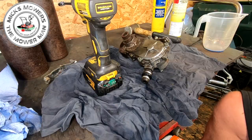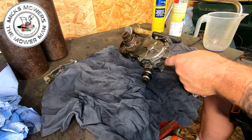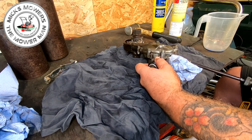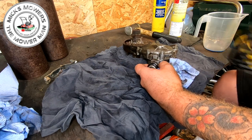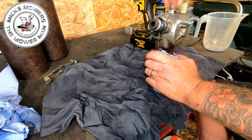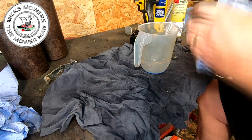Okie dokie. So you have got an oil drain plug on the back of these. Some you have, some you haven't. And it does give you the option to actually fill your oil up if you've got a bit of a leak or what have you going forward. So just undo that one, tip it up onto its nose. You can then remove that, and hopefully you'll get oil come out of it.